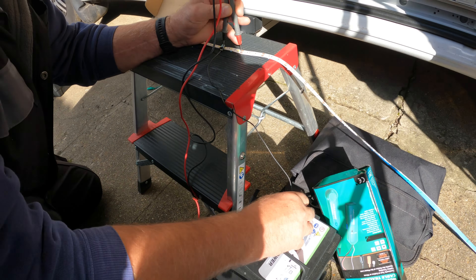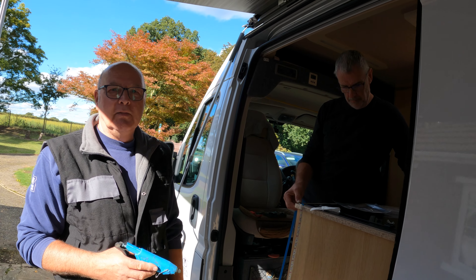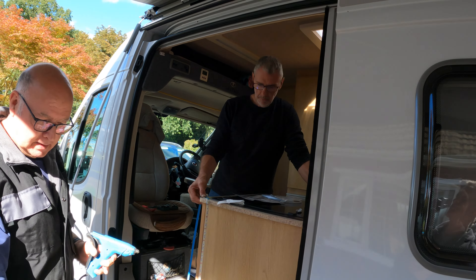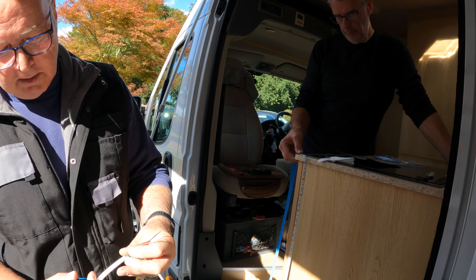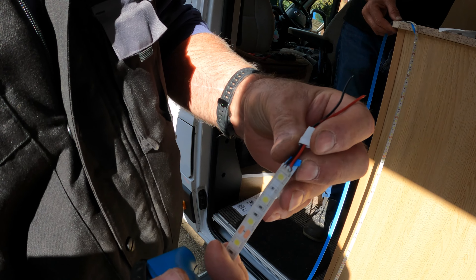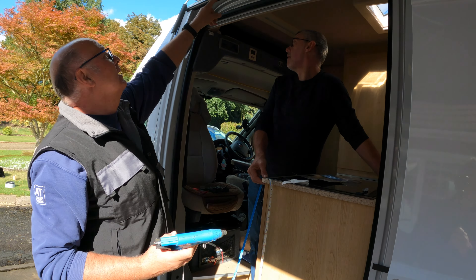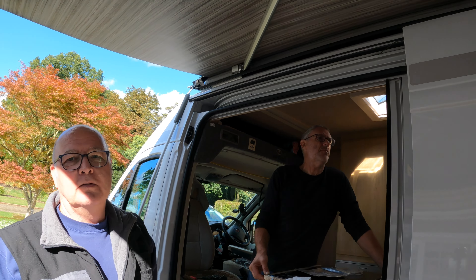They do make a little plug connector that you can clip onto the cable - you put wires in one side and feed your two positive and negative wires in, then clip the light strip into the other side. But because we want to join in the middle of the light run we've got to get the cable off the center of the light strip. If you've got the space on your vehicle you could just run the cable from the end of the light strip and couple it up that way. Getting the cable from back there all the way along to where we're joining it, you'd have to tuck cable underneath and it'd just keep falling out.